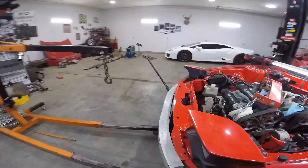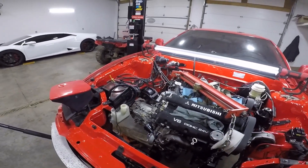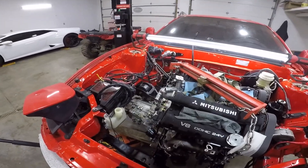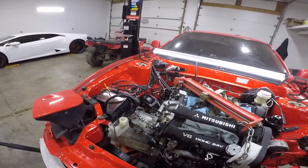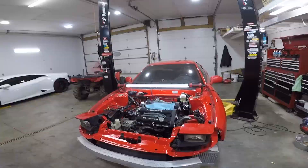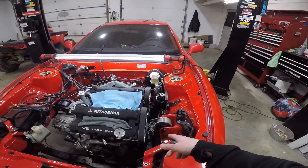I can't find the legit torque spec. I was looking at the forums and people were just arguing with each other — it's actually pretty funny if you want to go look at it. I think everything that goes to the body is supposed to be like 70 something, but then another guy says no it's 49. I guess I'm gonna do 50. If you guys can find the actual torque, leave it down in the comments. These bolts that go from the body to this mount I'm gonna do 50. Okay, got that engine mount on and all tightened back up.